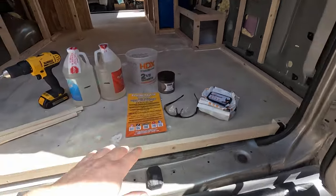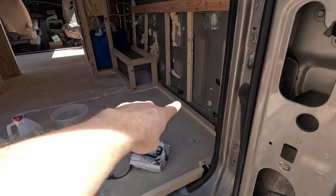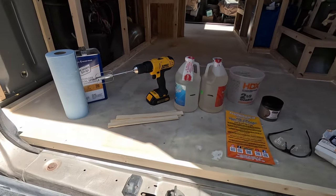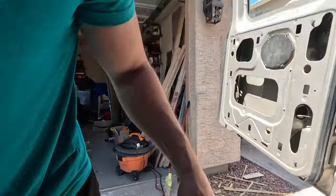Around the edge of the van, because I have plywood down especially at the door openings, I had to create a barrier so that when I pour the epoxy it doesn't spill over. So around the entire outside of the floor I have either framing or these one-by-two pieces up against the wall, with pieces on the openings. By that side door there's the same trim. Once the floor is poured and hardened, the pieces by the openings I'll have to remove. I put in electrical tape because it would be easier to get the wood off and then peel the tape off rather than the epoxy hardening to the wood and having to grind or cut it off. I could have used wax or a release agent, but the tape was convenient.